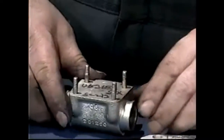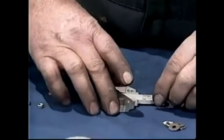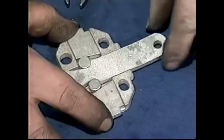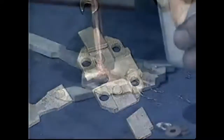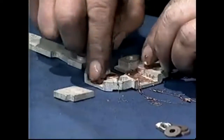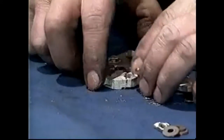Take your two nuts off — now the cylinder's got the studs in it — and we're going to assemble the expander device. The plate goes on like so. This is how the expander works: the pull on the rod sends the two pieces which push the shoe against the drum — see how free that is, how that works. We're going to put a bit of anti-seize grease in there. This can get full of water, so you want to put plenty of grease around so that it doesn't seize up.